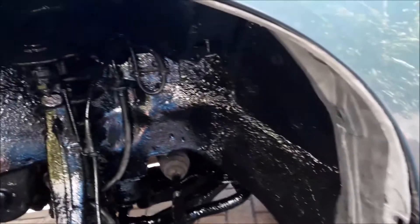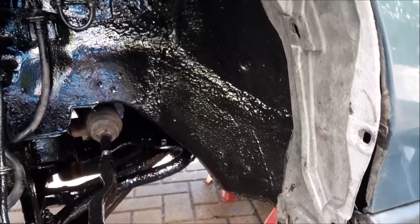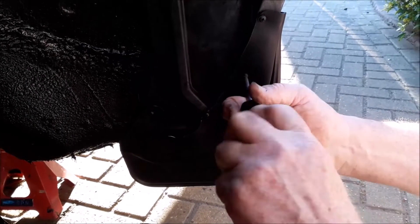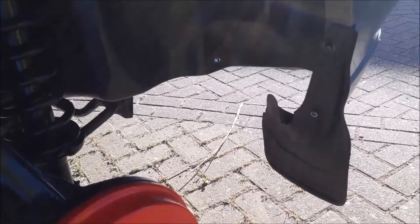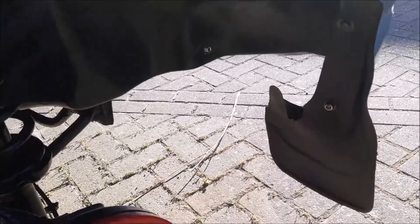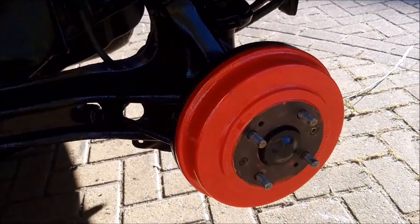We're fitting back the plastic liners into the front wheel arches with new little black plastic screw clips, and then we use black plastic cleaner to bring them back up rather than looking grey. All the suspension is painted as well as the wheel arches. At the back we've put on new mud flaps — the generic ones, which we find fit really well, in some ways slightly better than originals. We've used hex self-tapping screws to fix them, and all the plastic shielding and all the suspension springs are painted.